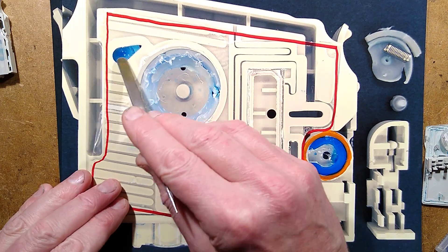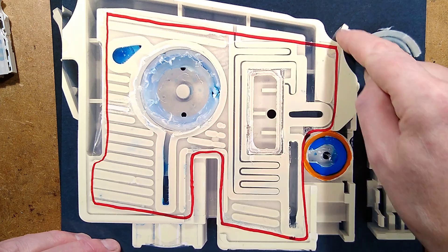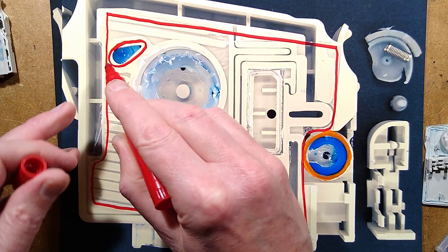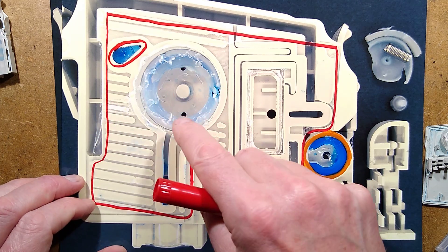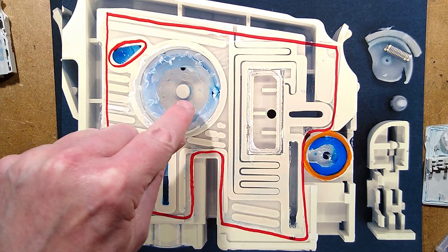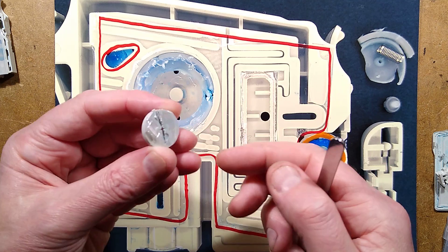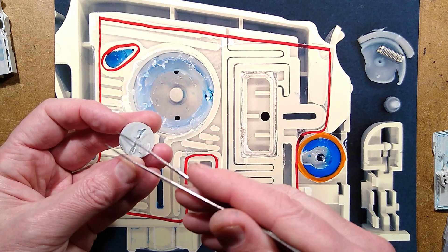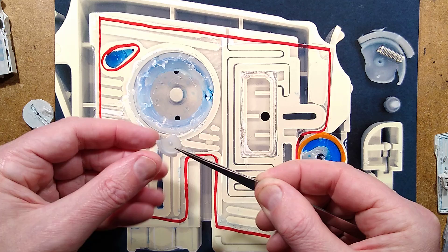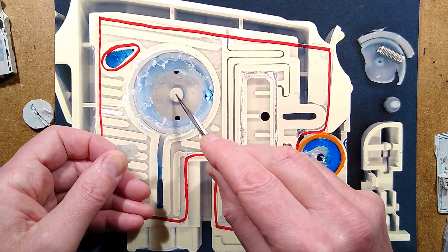So the ink bridges - there's the back of the filter and there's the little seal. Because there's a layer of plastic sealed on this side as well, it creates lots of little sealed areas that the liquid can flow from across barriers. The liquid flows into the chamber and then enters the other side, but the only way it can come through is via a silicone rubber diaphragm. There was a little silicone rubber diaphragm - very strange and squishy, very soft.